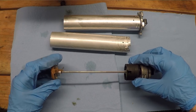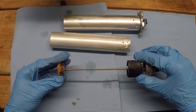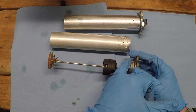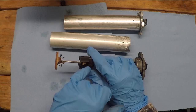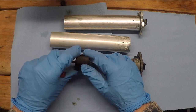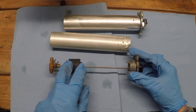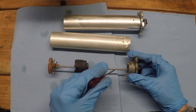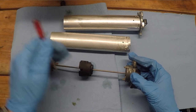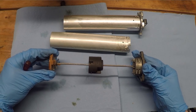The second obstacle occurs inside here. This is the bottom of the sending unit — it just screws onto the bottom of this central shaft. Inside are two very fine wires that go from the top to the bottom on both of these pins. This float rides down those wires on either side — these two little fingers that the wire goes between — and an electrical connection is made on both sides. As this slides up and down, it changes the resistance through the circuit, and that's what tells the fuel gauge what the fuel level is. When I was getting in there, I accidentally broke those two very fine wires, and there's just no way to fix that once they're broken — no way to re-solder it so that it has that tension anymore.